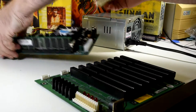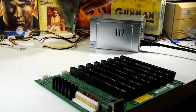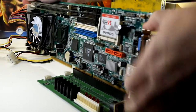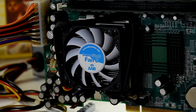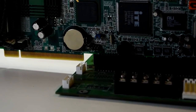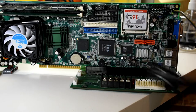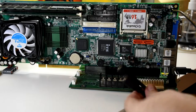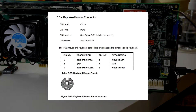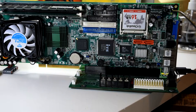Right now I don't have a case for it, as none of the ones I had spare seemed right for this type of machine, which means it's just going to have to live on the desk. So what have I done so far? Well, just a few little bits. I've replaced the fan on the heatsink as the previous one was completely dead. The battery has been replaced for very obvious reasons. And I needed to make a cable to plug in both the keyboard and mouse. Now this might look a bit ugly, but the PS2 port wasn't fully standard, so a bit of hacking resulted in this cable — I forgot to put the heat shrink on before I soldered the cables, so we just used some tape — but it has resulted in both the keyboard and mouse working as expected.